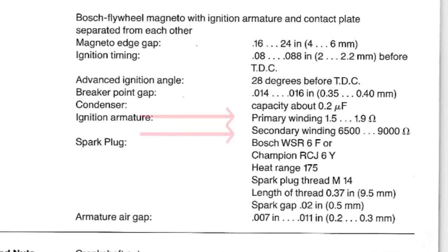On some ignition coils you will have additional electronic componentry on the primary side which acts as a trigger and a means to control spark timing as well as limit the maximum RPM that the engine can run at. The resistance values of your ignition coil may well be stated in the service manual, so that's the first place to look. However, if it's not listed, the values are fairly consistent for most engines across the board.